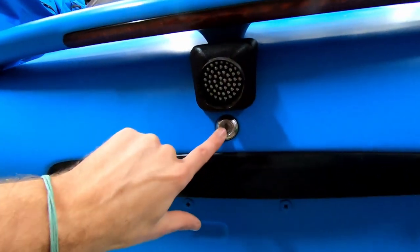Anyway, what we're gonna do is replace this. So instead of a lock, that's gonna be a button, and what that will do is trigger a central locking release which will pull the pin up and release the boot. Pretty cool. Why do I need to get into the boot? Well, at track days whenever I come into pits I pretty much always pop the boot up. A couple of reasons: one, it's a really nice place to sit when you're chatting to people; number two, it cools the car down — it's a big open area in the back and the car gets really hot inside. So when you come in, open the doors, open the boot, lots of air. And I also store things in the boot — chairs, toe plates, all the spare junk in the back of the car.